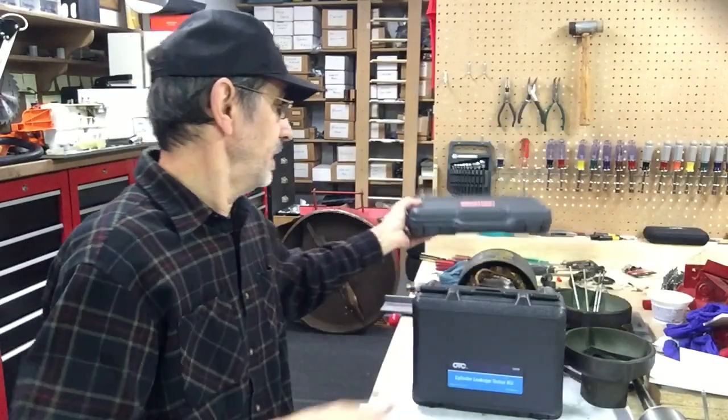So I couldn't get it to run. I originally thought it was a fuel pump because I put one on a year and a half ago, both of us, father-in-law and me, just before he passed. And of course, we bought an aftermarket one from Amazon, and it doesn't work quite well. To get it started at first, you have to put your hand over the end of the carburetor to really choke it before it'll start. Then after it warms up, the next day or two, it might start. Or you might have to take the air breather off and choke it out again to get it going.